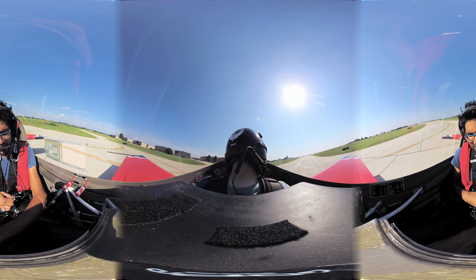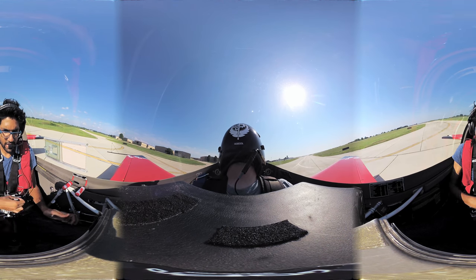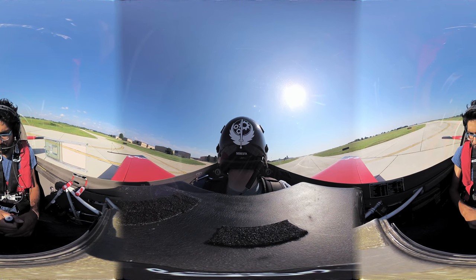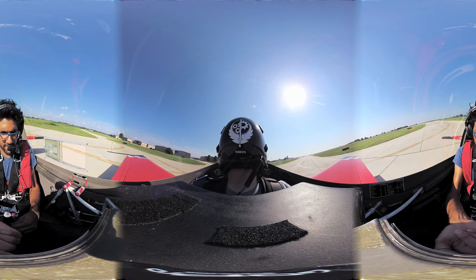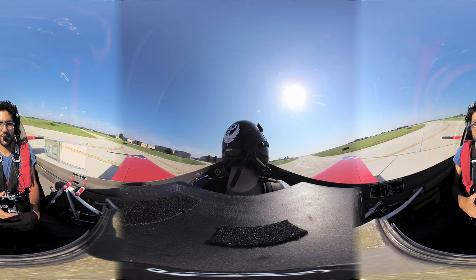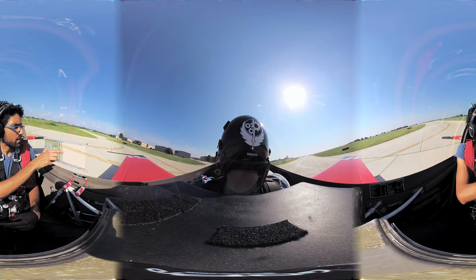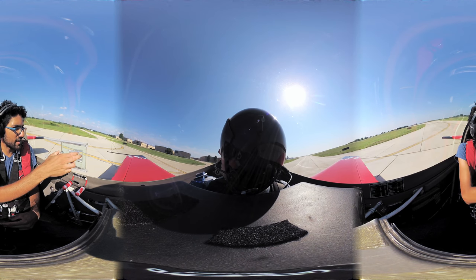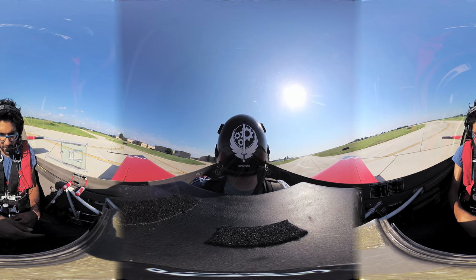Ammeter charging, slight positive amps. Controls — wipe them out. Controls are free and correct. Elevator trim is set neutral. Fuel selector on the Acrotank. Fuel pumps coming on. Seatbelts and harnesses are good. Canopy is back and secure. You can close the window and push the little window out — you get good airflow doing that. Transponder is ALT, radio is set.